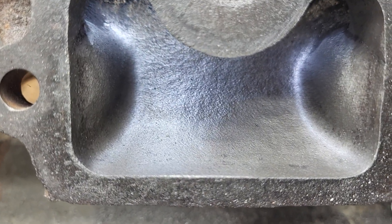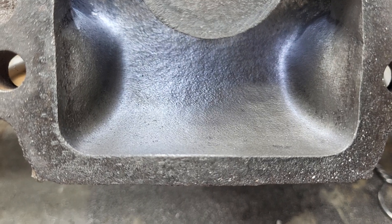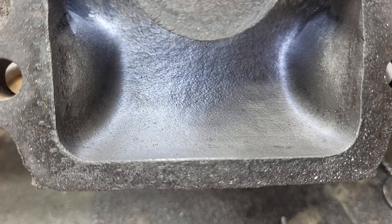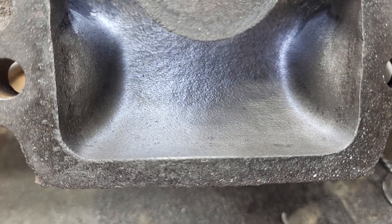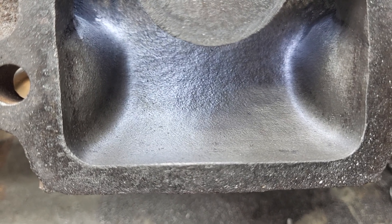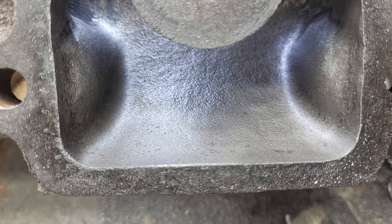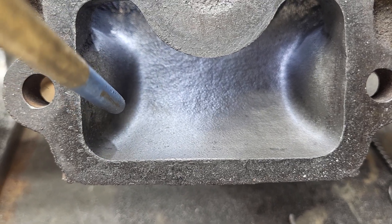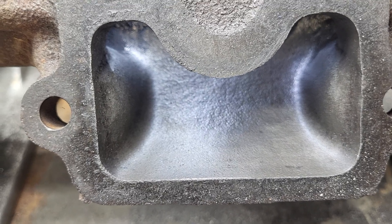The original shape wasn't really that much different, but there's all kinds of casting marks and jagged pieces. It's just done with the burr — I'm not going to polish it or waste any time doing that. It took quite a bit of time just to get the shape a little better and reduce the bulges, because the exhaust is coming straight out here and it doesn't want to hit this bulge. So work on that.